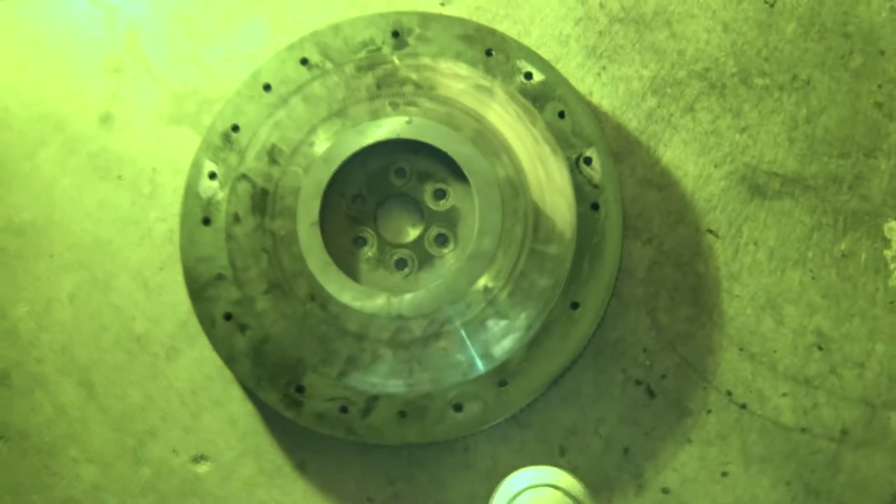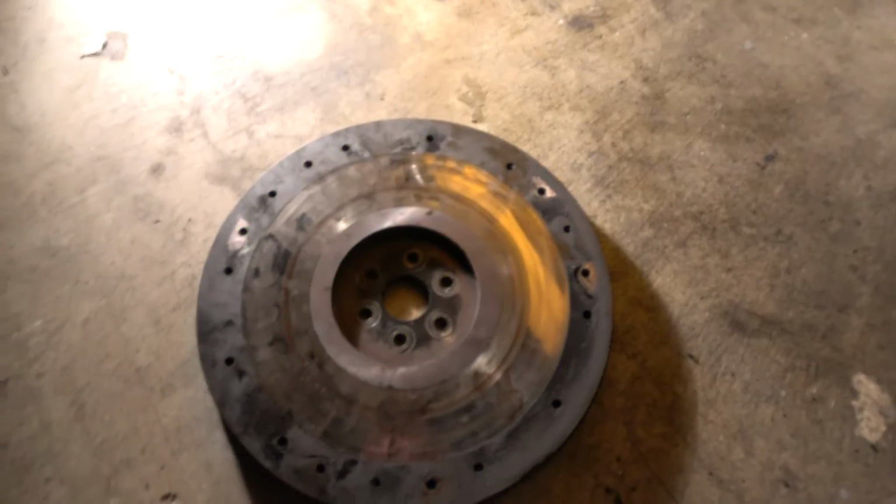I found out where my leakage is at. So, up there, let me put night vision, up there. So you see those six bolts that are from the flywheel. We didn't put Teflon on there, and so it ended up leaking oil. So that's why I'm leaking oil from my engine to the bell housing, which was pretty bad because that could cause some slippage. But anyways, I'm probably gonna seal that off with RTV gasket sealant.